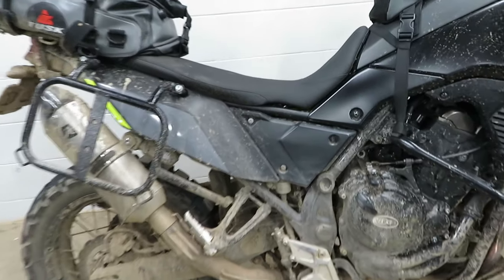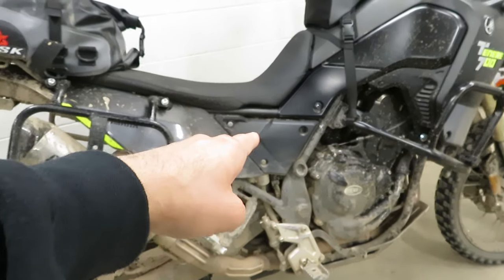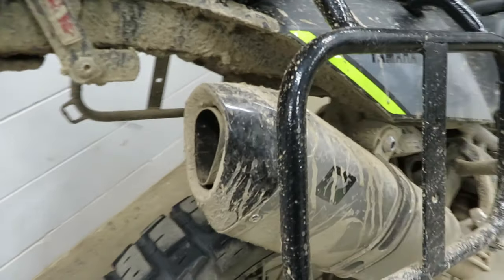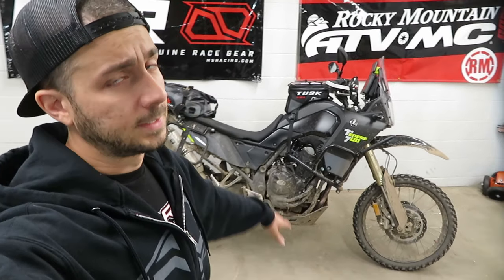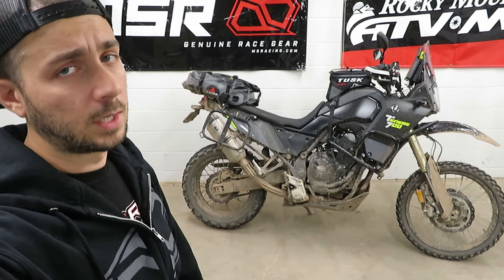The next four things are just the performance mods I've got done to the bike. Under the seat you can see the intake — a much more open intake with a frog skin on top and a Uni washable foam filter underneath. On the left side of the engine we've got the Camel ADV high exhaust kit, which is just a straight-through pipe. And to make sure I'm getting the most out of all those mods, I did have the ECU reflashed by Two Wheel Dynoworks. Specific videos on all of that are down in the description.